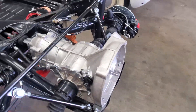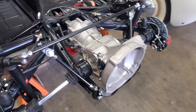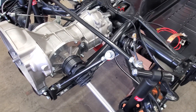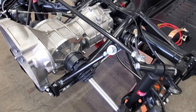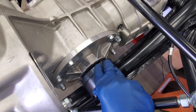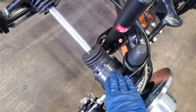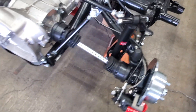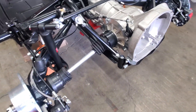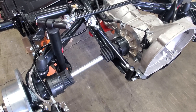That's it for the transmission — pretty basic, but it's very well suited to this car. Because of the torque the EV motor is going to make, we went and upgraded to Type 2 drive axles. MP actually makes an output flange for the transmission that lets you use Type 2 CV joints, and then we've got Type 2 stub axles on the outside to complete that. Much stronger than Type 1 stuff, because the EV has quite a bit of torque and we didn't want the customer destroying Type 1 CV joints.